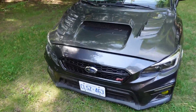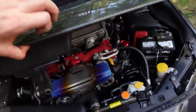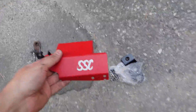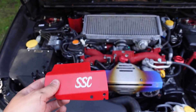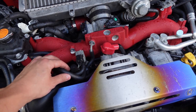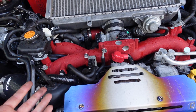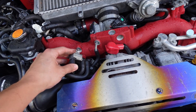Now let's get to the STI — the car I literally do not drive anymore and it's full of water. When I built this car originally I did the evap delete, which deleted this, so I just had my boost line running up into the intake manifold from this nipple. I was getting a check engine light, so I threw it all back in. I'm honestly hoping I can find a workaround — like a bypass, throwing resistors in or something. I've got to do a little more research on that.